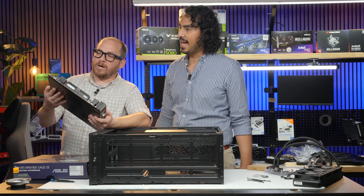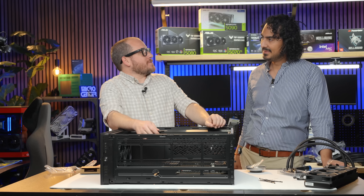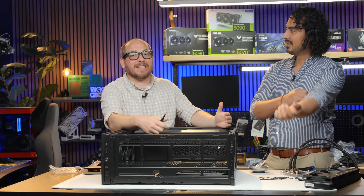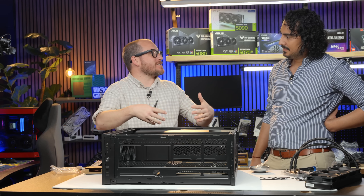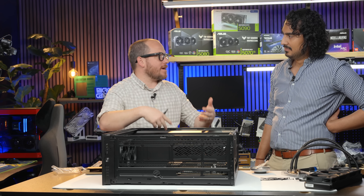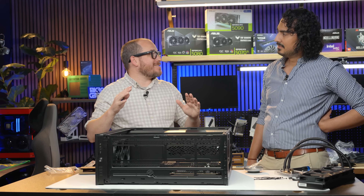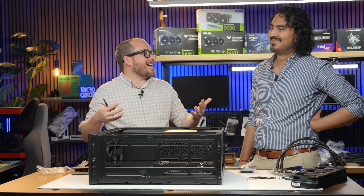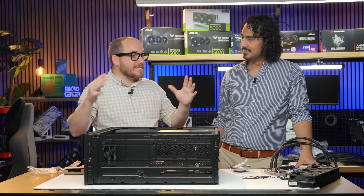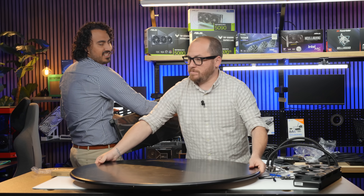For a build like this, Windows or Linux? ¿Por qué no los dos? I would install Proxmox — it's a Type 1 hypervisor that can host guest operating systems. You can have a bunch of different virtual machines with different amounts of RAM and CPUs for different purposes with whatever OS you want. I just learned to virtualize my NAS operating system so I don't have to run server stuff on the NAS anymore but it's the same machine.